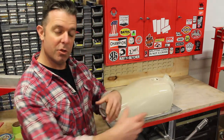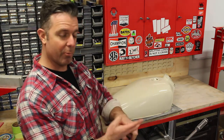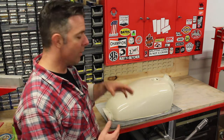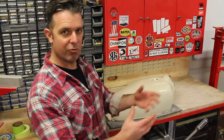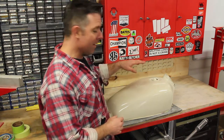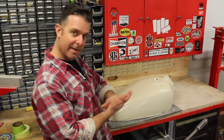If you're spraying with a spray gun and compressor you can control airflow and paint to reduce orange peel, but when you're spraying with an aerosol can there's not a whole lot you can do in terms of controlling the paint output. So we've got quite a bit of orange peel — wasn't unexpected — but we can colour sand it and flatten out the surface.